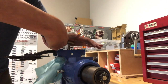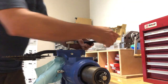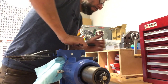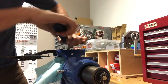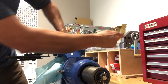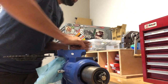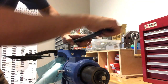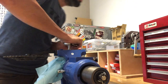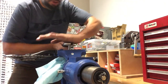Normally I'll use a T-handled holder, but the Park TH-2 wasn't quite big enough to fit onto the tool, so I had to improvise and use a crescent wrench — it worked okay, probably not the quickest and most efficient way, but it worked. Anyway, we're just threading this in here. I went ahead and ran the tap all the way through rather than backing it out once the threads were cut — that's usually what I'll do on pedal taps.